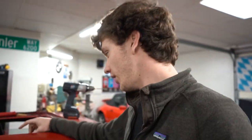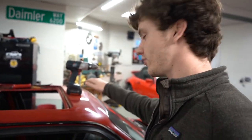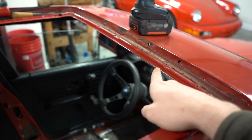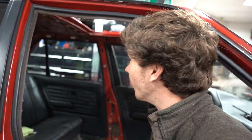So I began removing the sunroof cassette and I've already screwed it up pretty badly. This whole piece is spot welded in a few places and then there's a lot of seam sealer — like glue. I was trying to pry at it from the inside and may have added a whole row of dents from the inside. Whoops. But it's coming along — I've got most of the spot welds drilled out. A lot of it is just seam sealer all around the perimeter, and then there are probably about ten spot welds, so I need to get a spot weld cutting tool to cut those out and then pry the whole thing out. So I'm going to get to that so we can get the supercharger on this thing. I hope you guys enjoyed that — we'll see you next time.